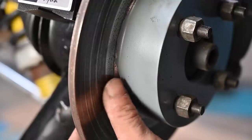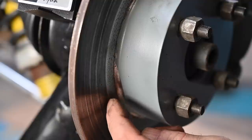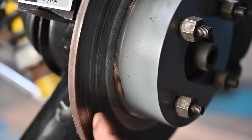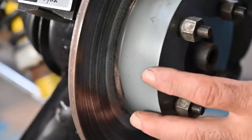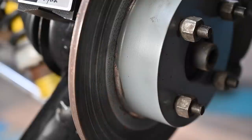You could replace the brake calipers if you wanted to, but what I typically do is check that they don't leak. These are not leaking at all - I just inspected them throughout. I'll take out the brake pads and put new ones in. If they do leak, I recondition them. I'm still going to take them off the car and shot-blast them with glass beads so they look like new again, then rinse the whole system. Since we're talking about brakes, we also need to look at the discs - this one feels quite all right actually, with no real grooves. These discs are very cheap to get, so you might as well get new ones.